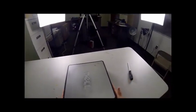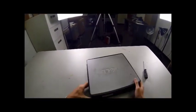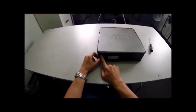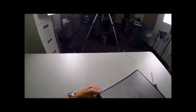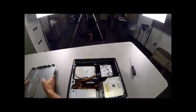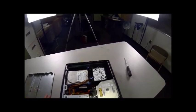To get started with your Dell, you've got your case here. To open it up, you're going to pull on this tab right here in front of you. It's on the top of the case. It's got this little loop right here. You slide that back, it pops open the side, you lift it up, set it to the side. That's done.